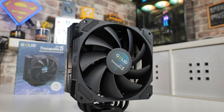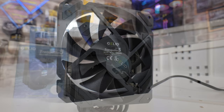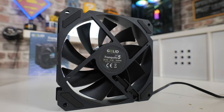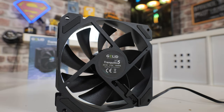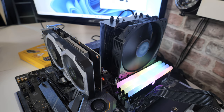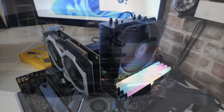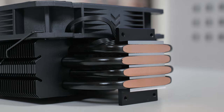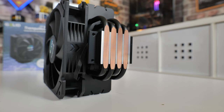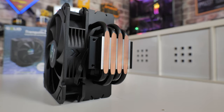The fan itself is really decent — lots of static pressure. They rate it between 700 RPM and 1600 RPM, although in my testing it would go from 0 RPM — basically completely stationary — right up to 1700 RPM, and even at that top speed it's actually pretty quiet. All the way up to around 1500 to 1600 RPM it's basically completely silent. Even at top speed there is a little bit of noise, but it was considerably quieter than the graphics card installed. Looking at the bottom, there's a really nice cold plate with four exposed 6mm heat pipes. It's a universal size, so you can mount it either way around. There's also a 4-pin PWM connection on the fan, as you'd expect.